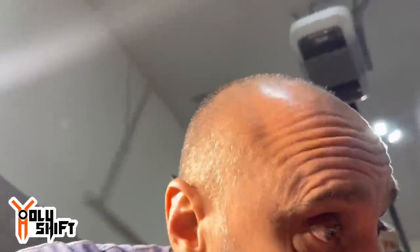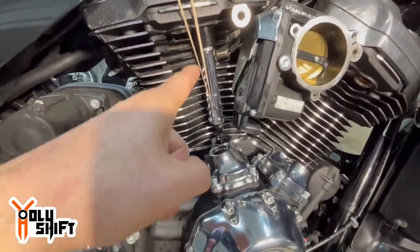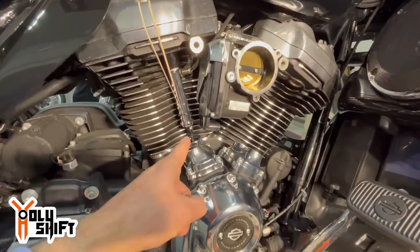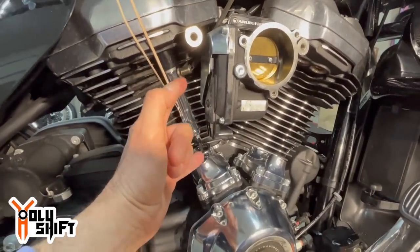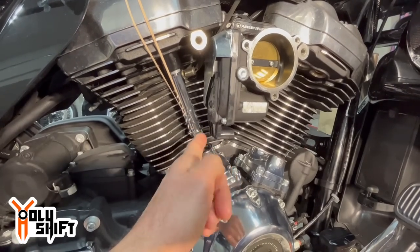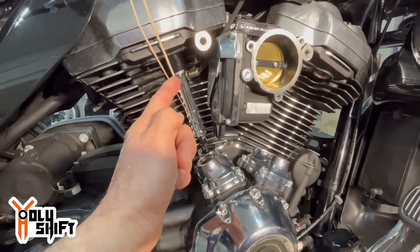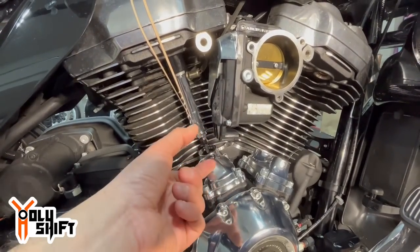Okay, guys. This is a very technical area. You've seen this on the Flying Rides video: how to adjust the proper length of the adjustable push rods. I'm not going to go over it again, but once the top and the bottom are touching and you feel zero movement, that is the point where you mark it. Then you start rotating one direction, holding the bottom to the other direction, and that way you make it bigger.